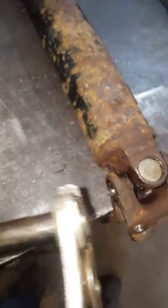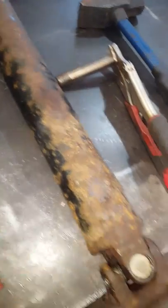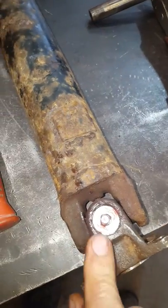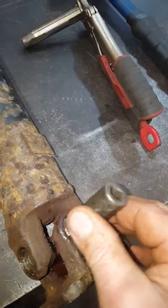What I do is just drive them in using the pin the same way, but when doing it that way I use this beat-up brass hammer so I'm tapping lightly and not banging it too much. This one has a grease zerk right there, so in order to drive that cap, simply use a 13mm impact socket, slip it over there, and you can drive that cap down without wrecking the grease zerk. Get it all together, grease it a little bit, and there you go.